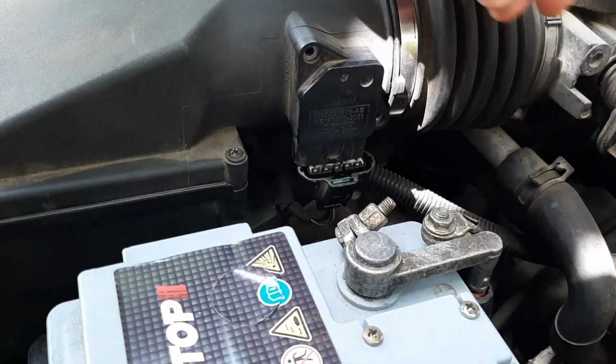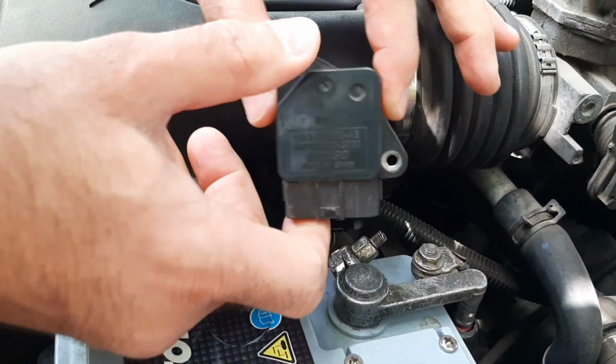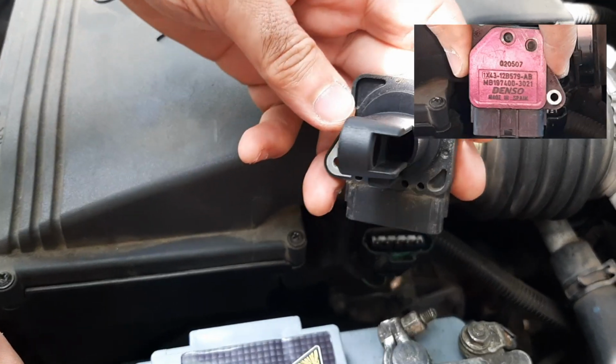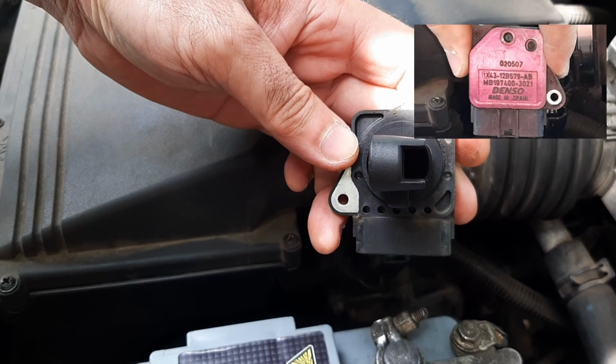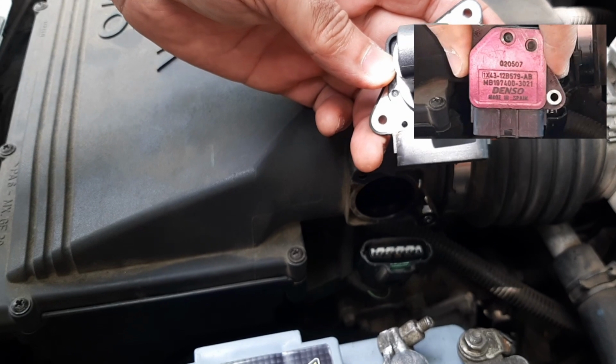Removing the mass airflow sensor is quite simple. Just unplug the connector and unscrew the two screws securing it. Be careful not to short-circuit the positive terminal of the battery situated nearby with a screwdriver. The part number of the mass airflow sensor of the Jaguar X-type will be given in the description below as usual.